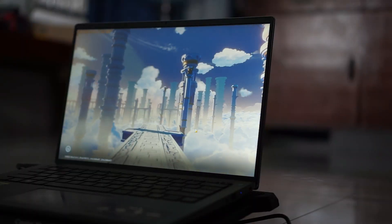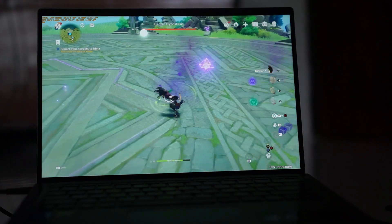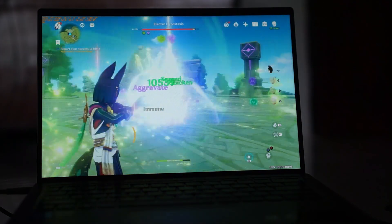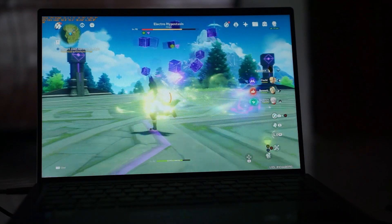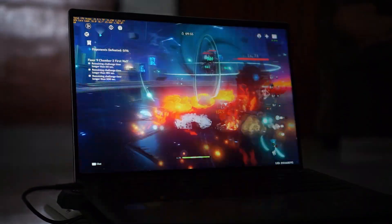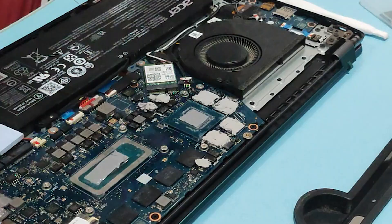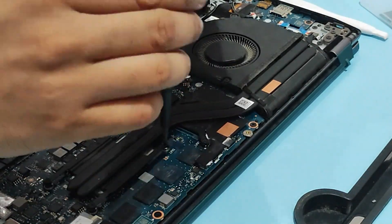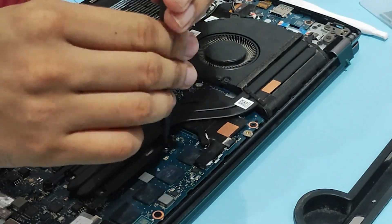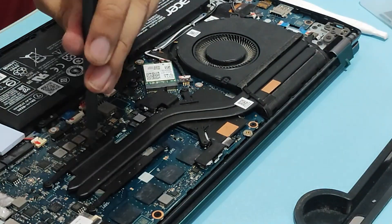To conclude, Honeywell PTM-7950 and UpSiren UX Pro Ultra were able to improve the thermals of my laptop. Though it still thermal throttles, overall performance was improved because heat is dissipated faster after the change of thermal paste and pads. Improvements may vary per laptop due to different thermal designs, but PTM-7950 and UpSiren UX Pro Ultra are among the best solutions available today.